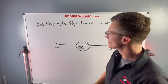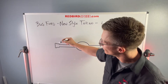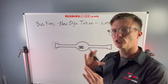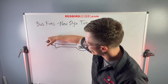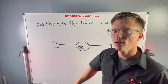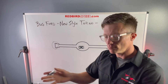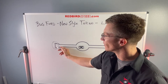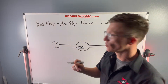So what this is — this is the part on the end of your axle tube right here. That housing end is going to be what takes your bearing. Your axle and your bearing are going to come in here. It's going to be your bearing pocket. You got T-bolts that come out through here — that's how you secure and bolt your brakes on and retain your axle in. And your bearing rides in here.